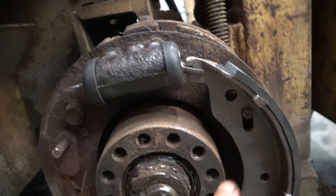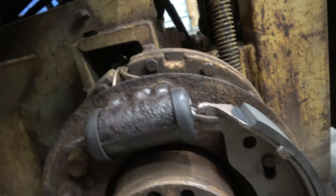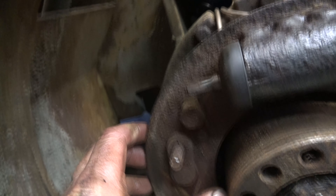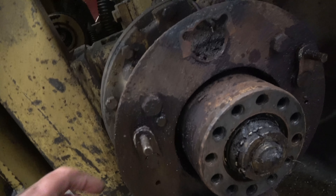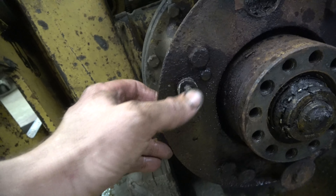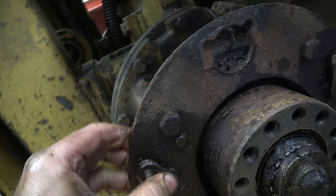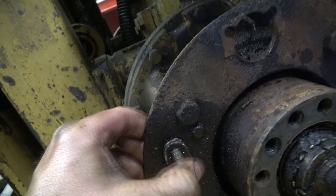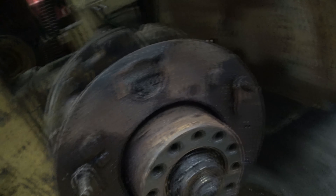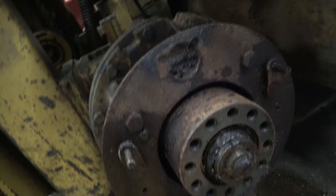I'm going to fit these shoes on here, and they clearly have to go on this pin to get up into here. But these pins are stationary — I'm thinking, how can that work? If that's stationary, this will never work. I went over to this side, same thing, and I just started beating it back and forth with a pin punch. I'm pretty sure this is supposed to pivot right here. So I'm going to work on these and get them all to pivot. These brakes probably haven't worked in like 30 years.